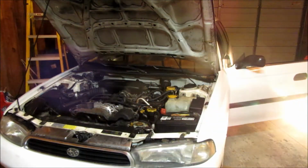And I'm going to go through most of the basic steps over this. First thing I'm going to do is go through the bench prep, so I'll show you that here shortly, and then we're going to go through basically every connection into the car. It should be pretty simple. Even if you're not doing the same exact remote start, similar direct electronic Viper systems will have the same wire coloring, so you should be able to figure it out from there. Even if the wire colors are totally different, the same basic concept will be here, and I'll show you where I tag all the wires and everything, so it shouldn't be too bad.